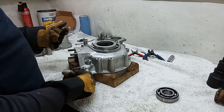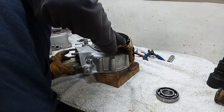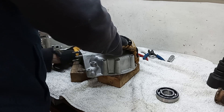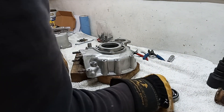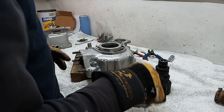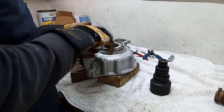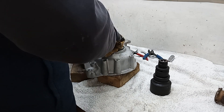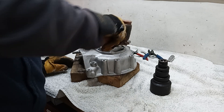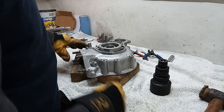Here's the drive side, just up on blocks because there are a few bits sticking out the bottom. Bearing's been in the freezer. I've got a drift to drive it in if I need to hammer it - try to drift on the outer ring of the bearing, not the inner, and the lettering facing outwards. And it's dropped straight in, look at that - smoking away. Marvelous, done.